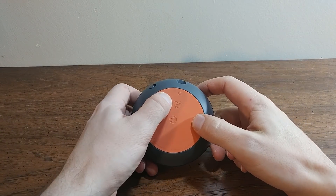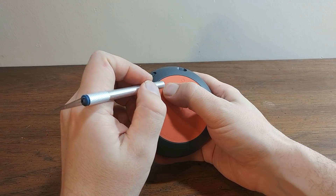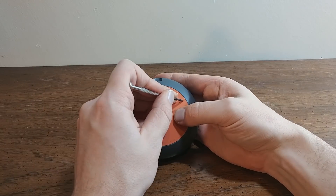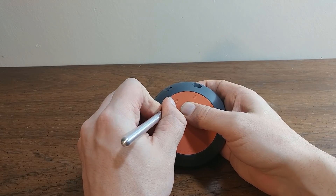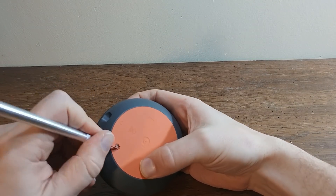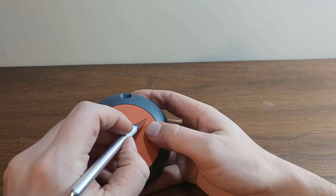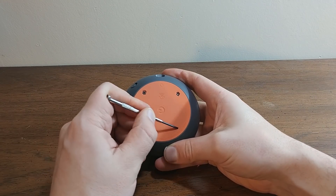I've seen other videos where people disassembled their Google Homes and it was very hard with heat to take the orange off the bottom. I decided I don't want to do that because I'm going to probably want to get in there again. So I just searched to find where the screws were underneath the orange and once I had located them, I cut a little hole for the screws. It was quite hard to find because it isn't just soft rubber — there's actually a thin layer of plastic between there. With much careful searching, I was able to locate them. You get a rough idea by looking at a picture of where they should be, then just feel around until you feel it and then carve away for the screws. That way you don't have to worry about heating off the adhesive whenever you want to take it apart.